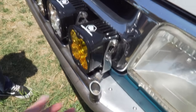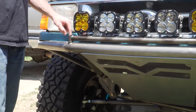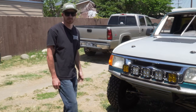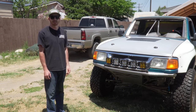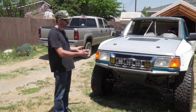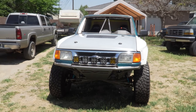On this setup there's a normal nut — not threaded. You put a socket through the bottom, socket on the top, and just pop it out. It's a three-eighths bolt that holds it on both sides. We'll probably end up putting safety hardware on the main bar itself and on every light as a theft precaution, because if he's driving on the street, the reason it's removable is so he can pull it off. But with my last truck, I had the same option and after a desert trip I just stopped pulling the lights off. Once you see it with lights, when you pull them off it just looks funky. So they'll probably end up staying on there.